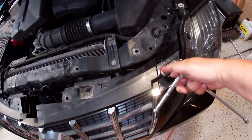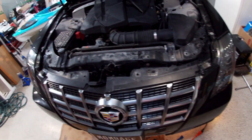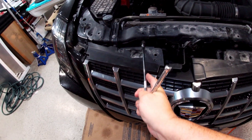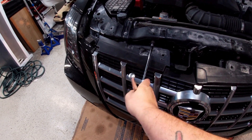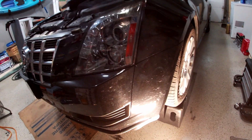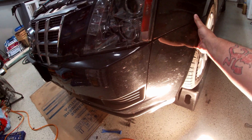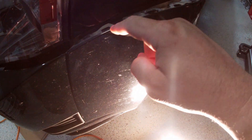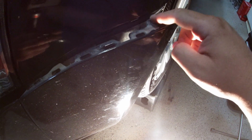Once you pull them off, after you've removed the bolts from the wheel wells and unhooked everything at the top, we're about ready to pull this off. All the body clips are off from the bottom, the top, and the wheel wells — the bolts are removed. There are only two bolts left holding this assembly on, right here on the top. We're going to go ahead and take those out and then pull off the whole bumper cover. Once everything is removed, this part just pops out — it has some little clips right here that hold it in there, plus that nut in the back that holds it tight.